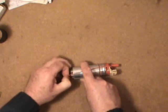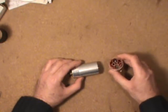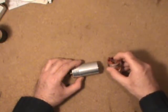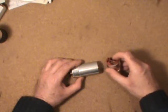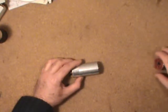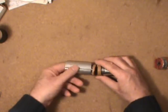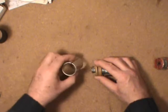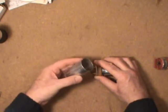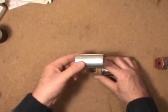Get the elastic band off — you'll notice the end will probably spring off. There we go, that's what the elastic band was for. There's the end cap, and there's one of the brushes. The other brush kind of fell out, so I can show you that in its entirety. The whole unit just kind of slides out like so. It's just an aluminum canister, not much more than a glorified pop can, only made specifically for this part — that's the outer housing.